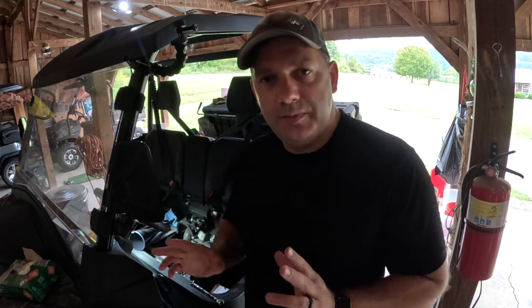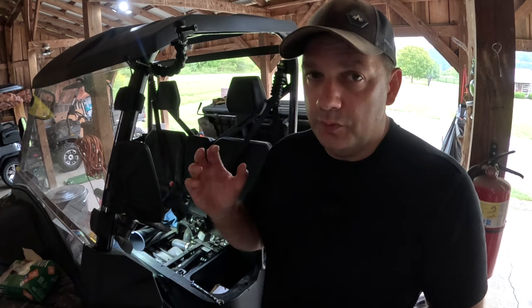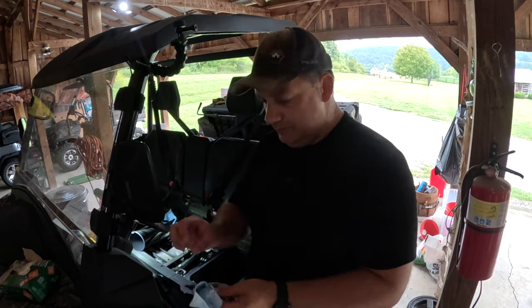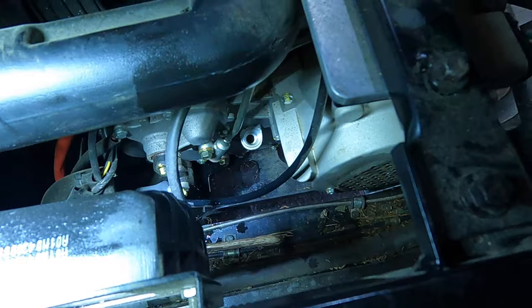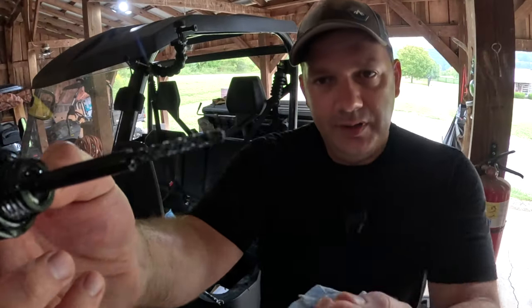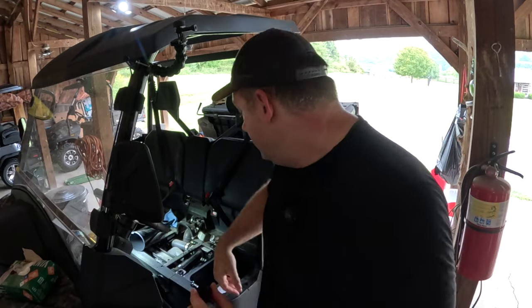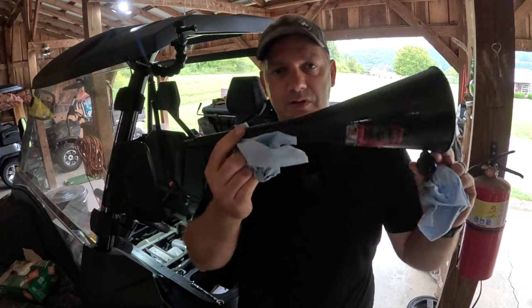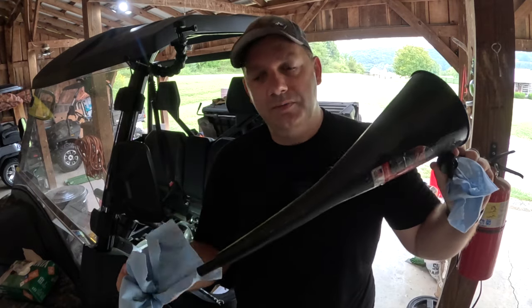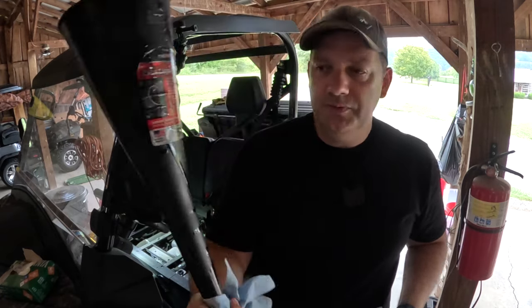So this is pretty easy. Two things I would say about this machine: all machines are very simple to service. If you've never serviced one before, this is something you can absolutely do. On this one, you have to really dig down into that compartment to get to that oil dipstick because it will screw in — it's very stubby. You have to reach kind of around all the muffler. These hash marks are going to tell you if your oil is full or not. I went ahead and refilled it. You will want to have a really long funnel because if I didn't have this funnel, I'm not sure what I would have been manufacturing here. I have a long funnel — this one is just Flow Tool extra large funnel. I have no idea how long I've had it, but it did its job today.